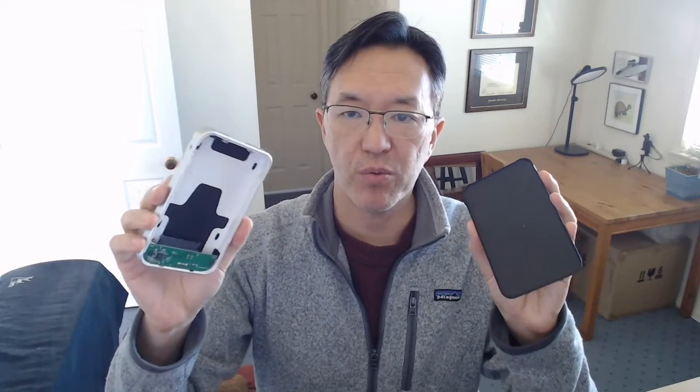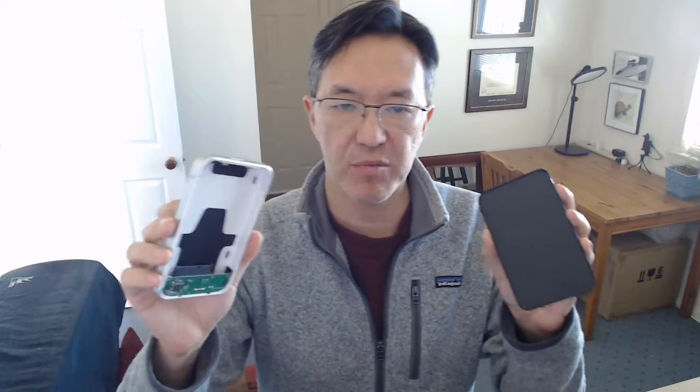So you've got the hard drive out, which is what we're after. Pretty much the rest is easy. I happen to have a 2.5-inch hard drive caddy made by Sabrent. This exact model is no longer available, but I'll leave a link in the description with another model that will work fine. These are available on Amazon — there are tons of them, they cost about $12. They're standard drives that work with Mac or PC. What you'll get is a caddy and a cover. I recommend getting one that has a metal container — I like having that shielding, since this is going to be right next to an antenna. It opens up through four screws on the sides.